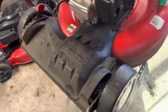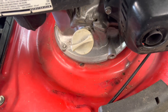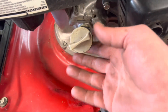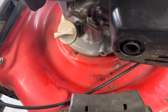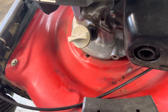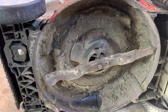So what's next — we're going to be changing the oil and doing the blade. These Hondas do not have a drain plug, so what you basically do is take this dipstick tube out and tip the mower up on its side and it drains out that hole. You could pump it out too if you wanted to, but it's just as easy to tip it. Then we're going to pop the blade off and clean up underneath a little bit.